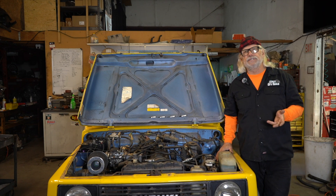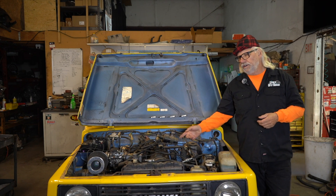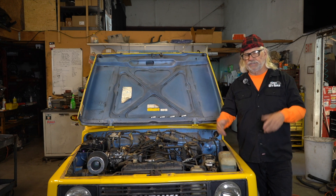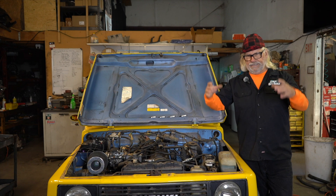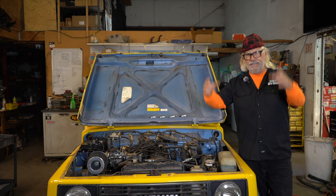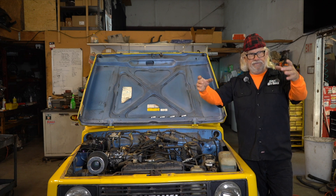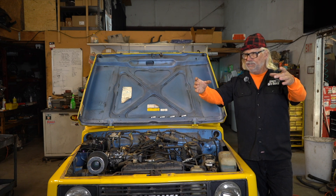What's a pumper motor? A Harley-Davidson's a pumper motor. All of the G motors for Suzuki — the four cylinders — they're pumpers. You have two top dead centers: one and four going together, and two and three go opposite. So when one and four are up, two and three are down. One and four — one is compression, one is exhausting.